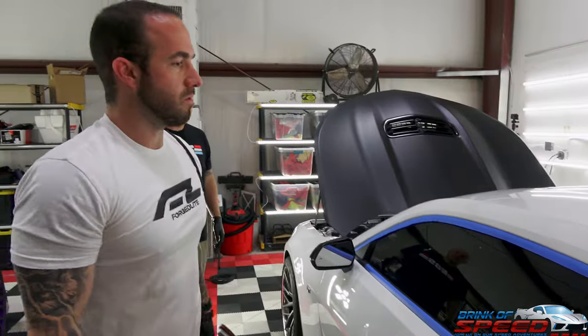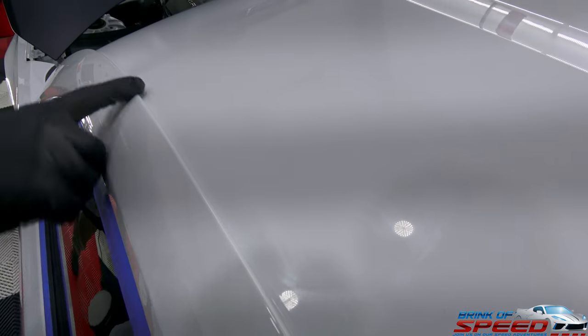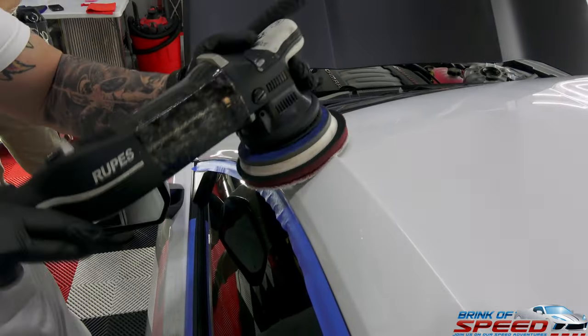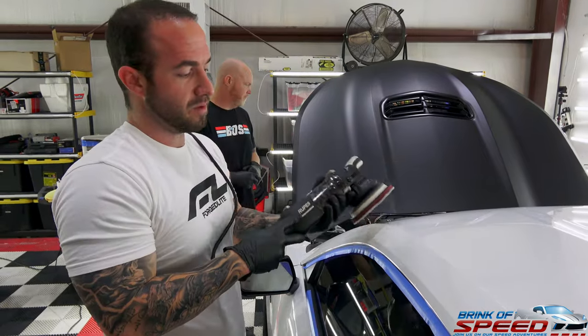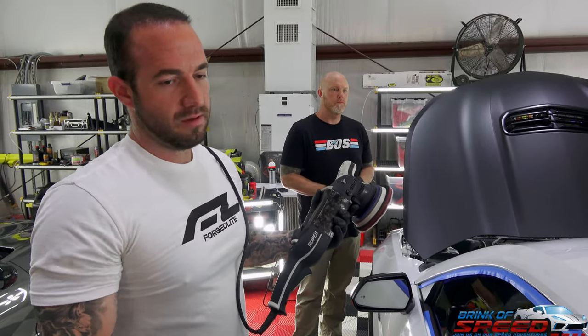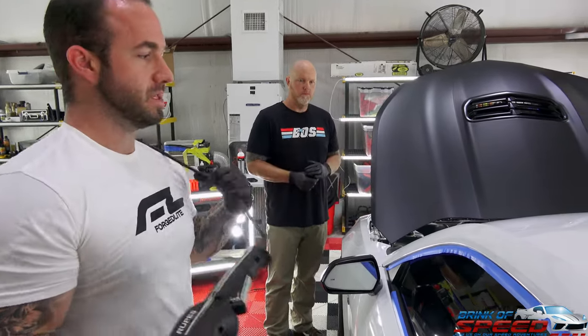You're constantly overlapping yourself as you move to the next shoe box area. What some guys worry about is burning through the clear coat. The only time you're going to do that is if you're going way too hardcore. On a hard edge like this, we're not going to hang out on the edge — we work on the flat part where the side of the pad is barely hitting that edge. Even still, it's going to take a lot of pressure and heat to burn through this clear coat — it's five mils thick. So don't be scared about doing this step; you can easily do this at your house.